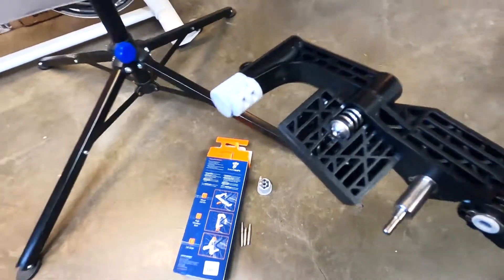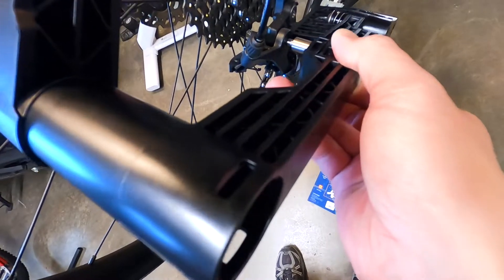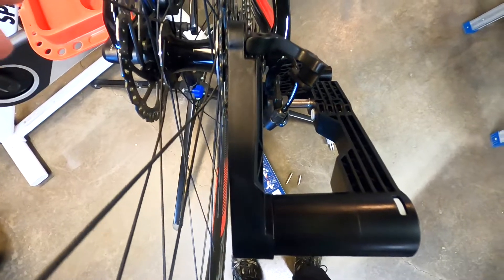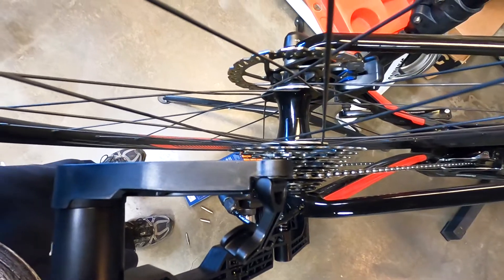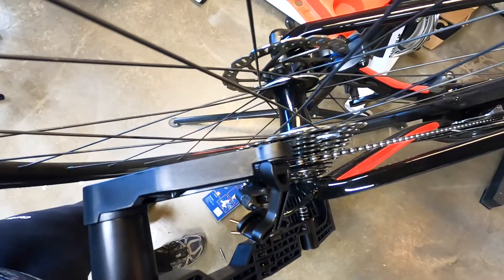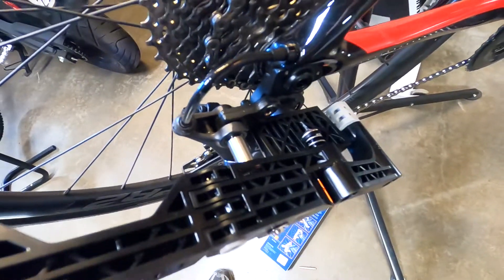Here's the reason why I chose this pin. Insert it like so. The reason I went with this pin is because it allows enough space so the rim spokes won't hit the device. If I use any shorter pins, it gets closer to the spokes. That's one thing to consider that I don't know if they cover in their how-to videos — something I noticed when going through the various pin sizes. So depending on your application, you'll have to play with that on your own. This is a Shimano derailleur, so I'm using the Shimano pins.